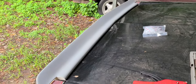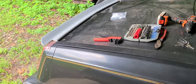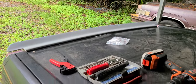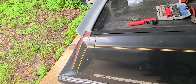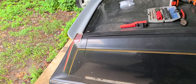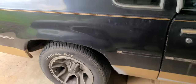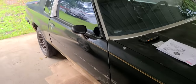This is a fiberglass reproduction, and if anybody's thinking about ordering one, let me tell you now — when you get it, it will not fit. I had to do a large amount of sanding to get those gaps to look right and to get it to lay flat. It's still not a hundred percent flat. My body man might be able to fix it — I'm even thinking about having him mold it into the trunk so it looks like one uniform piece. Could panel bond it, fiberglass it, and hopefully the system vibration won't beat it apart.